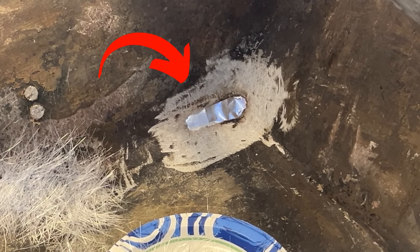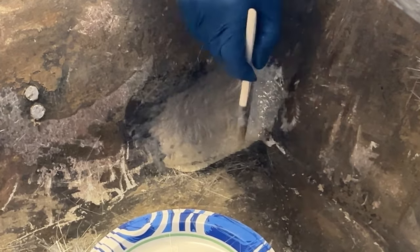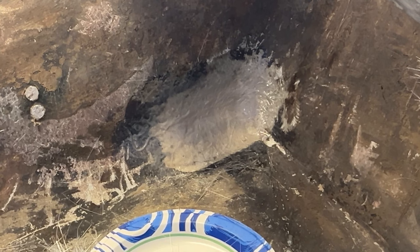There was a crack here — I laid in the fiberglass resin with several layers of fiberglass to make it nice and strong. Also redid the well where the gas pedal goes — that's always cracked right there in the seam — a couple nice layers of fiberglass there, so that should be fine. What happened here was they had the exhaust going down there and it burnt the fiberglass right there, so I cleaned all the burnt fiberglass off, put some foil tape behind it, I'll fill that in and dress it up from the underside later. Once you get the fiberglass mat on, you just tap it with the end of the brush to make sure all the mat is soaked, and it turns out great.